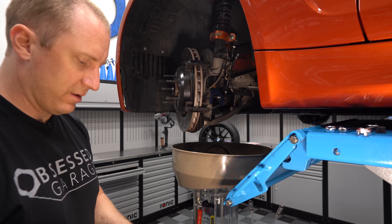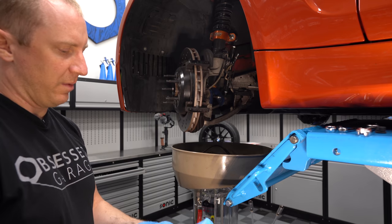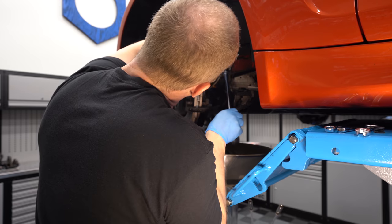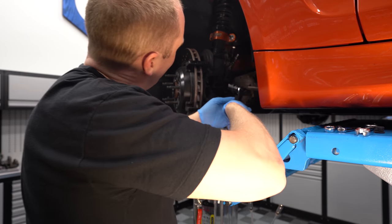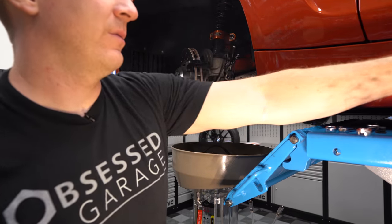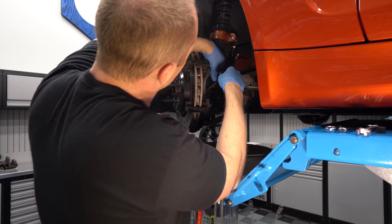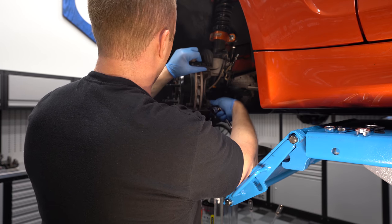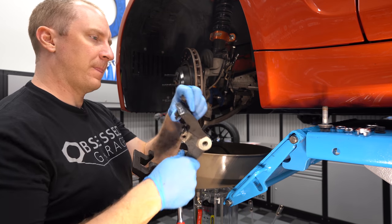Since that initial messy step is done, I'm going to swap out my gloves. These aren't 16mm — they're 18mm. Once you break it loose, it's pretty easy. So this is the caliper bracket, which we'll be swapping for the Brembo aluminum bracket, but we're going to reuse these bolts. First things first, we've got to take the rotor off, and I'll show you we're going to cut the back plate.